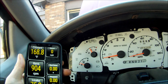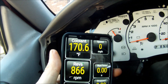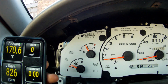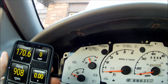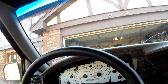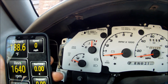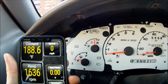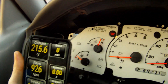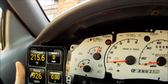With the 1.1 kilo-ohm resistor, the gauge is right in the middle at 170.6 degrees Fahrenheit. At 188 degrees it still looks okay. But the check gauge came on at 215 degrees Fahrenheit with the 1.1 kilo-ohm resistor, so next I'm going to try a 500-ohm resistor.